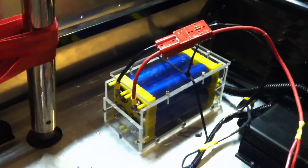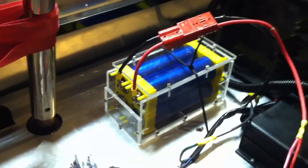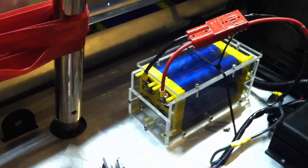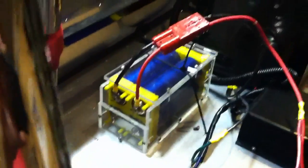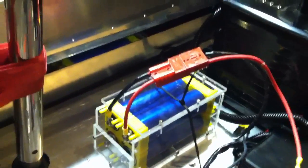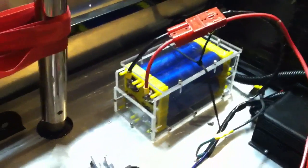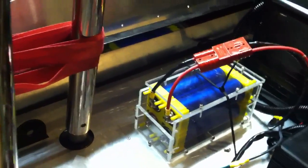Video 18. This is the new 12-volt battery to run the 12-volt stuff in the car. It's a Headway 16-and-a-half amp-hour four cells all put together in a series configuration — just a plain old 12-volt battery with no BMS at this point. I'm probably going to put one on though. I'm looking at a couple of small ones to keep this 12-volt battery well maintained.